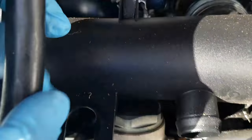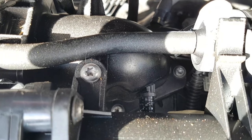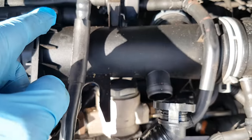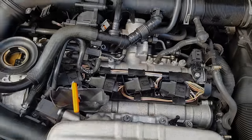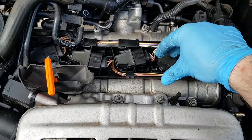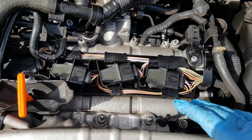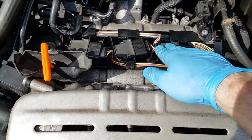One mention I made earlier — down here, where this pipe goes, there is a rubber grommet that's a bit moist with oil. We need to get that off and get it back in the end of this pipe, and then it will slide on. You'll struggle sliding this on while it's installed, so you need to put the grommet into the pipe first and then slide it back on. That's probably the fiddliest part of the job aside from getting the coils out. Once the coils are pushed back in place, it is always good practice on these coil packs — since there's nothing holding them other than the coil pack onto the spark plug and around the spark plug tube — to give them a tap on top just to make sure they are fully seated down, because you don't want any of them working back up with engine vibrations causing a misfire. Just always give them a little tap. That applies to all Volkswagen, Audi, or any coil packs that aren't bolted down.